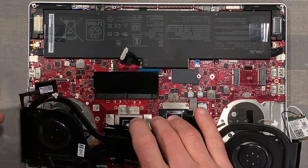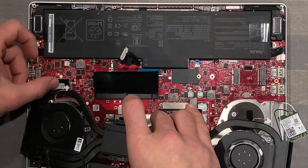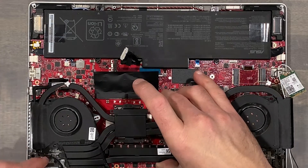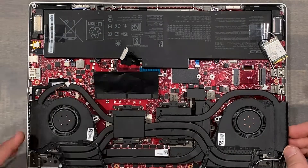Time to reinstall the cooler. I'll carefully hold the cooler close to the motherboard with my right hand as I insert the display cable into its socket on the motherboard with my left hand. Pay attention to the Wi-Fi antenna and fan cables — you don't want those caught where they don't belong.